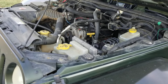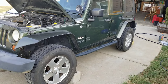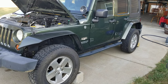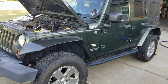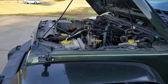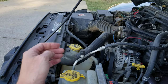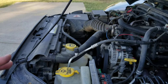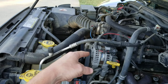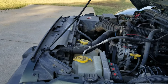I did a little research and found that I needed to put the Jeep on an elevated incline. The back tires are just a little bit lower than the front tires, which pitches the nose up. That allows what I assumed was air in the coolant system to come up towards the top of the radiator, since that's the highest point, rather than settling in the hose or the top of the engine.